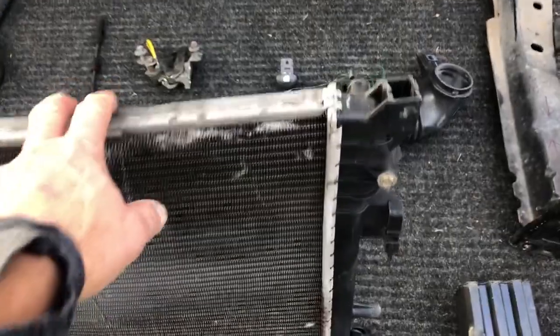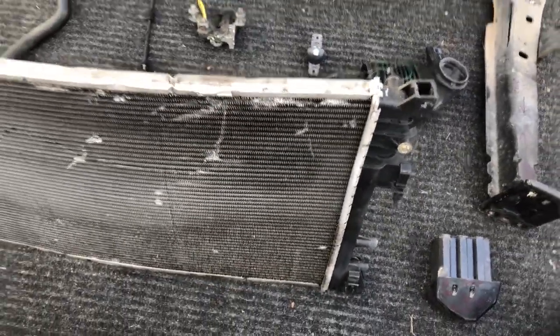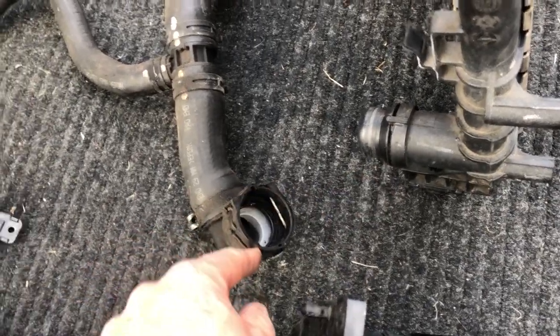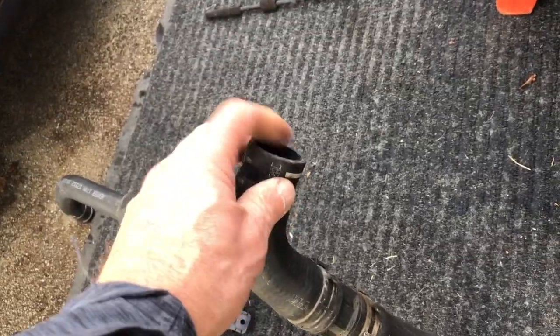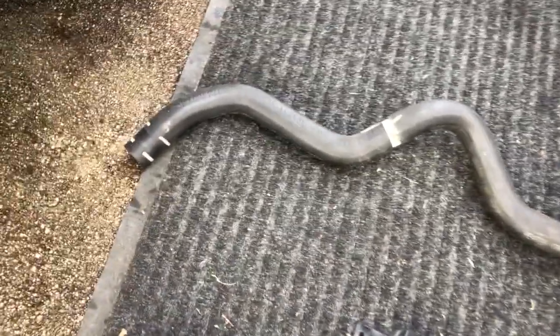Check out the radiator — this nice thing was still holding coolant, believe it or not. Look at the trauma it took — completely deflected. I replaced it, but I did not replace the air conditioning condenser. That was still holding Freon, so I continued to use it as shown in a previous video. Right here you can see how the lower radiator hose ties into the base of the radiator with a little spring clip assembly. The only thing wrong was this metal pipe got a little oblong-bent from the crash, and that's why it was leaking. I replaced the whole assembly — about $46 at a dealer. That line runs up to the coolant reservoir bottle.